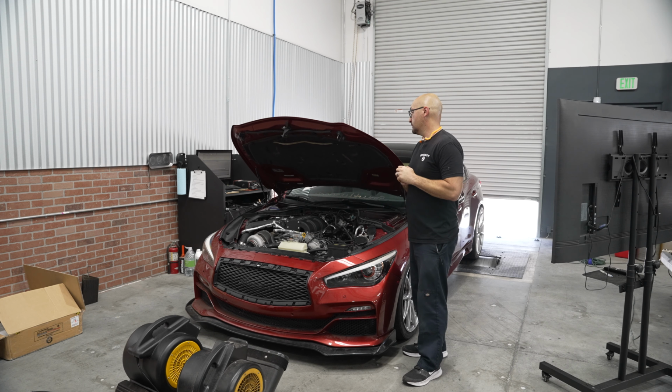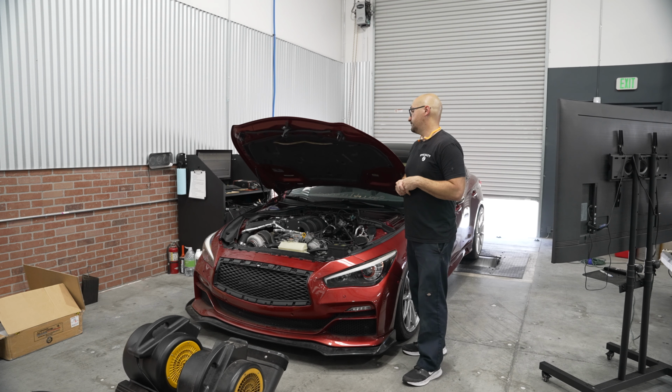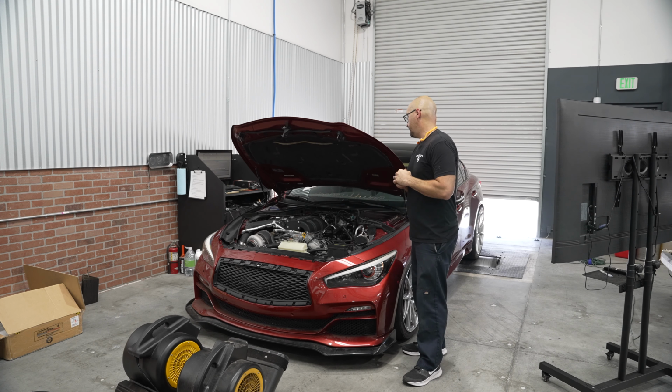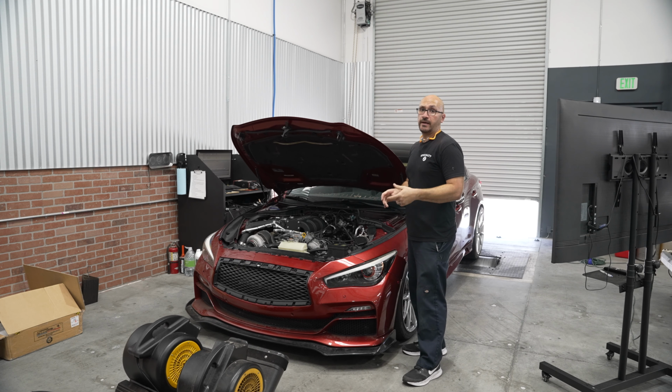setup on there. Again, you gotta remember you got all 6 cylinders running through one turbo, so you really gotta match the right turbo for that. It's gotta definitely be way bigger than your little twin turbo setup that you're gonna do. So all in all, it's alive, it drives, it makes fairly good power. So can't wait for Luis to get it back in his hands.